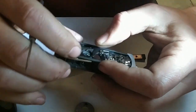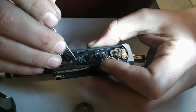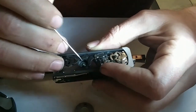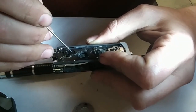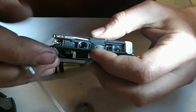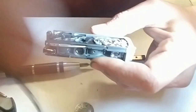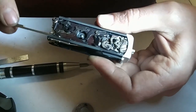This is the cam that controls your film advance stroke. This is the lever that actually advances the film. This little finger right here runs on that cam under there — it moves this up and down, which interacts with this cam surface, which changes how much it strokes. I think that's about it for taking it apart as far as I've gotten into it, and as far as I usually need to get into it. Let's put the little rack back on there and show how it ratchets. This just slides under there — a little spring ball — and that's how it ratchets.